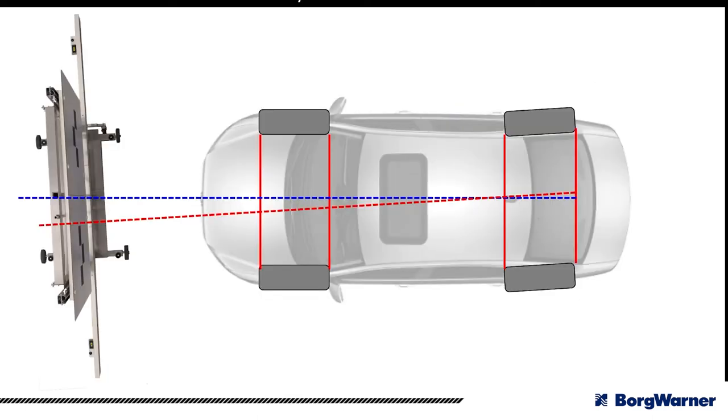The camera and radar are all set off the rear axle, which is called the thrust line. The blue line represents a straight line through the centre of the body and the red line represents the angle of the rear wheels' toe. In a perfect world the toe would align exactly with the thrust angle, but in reality vehicles are made to tolerances and will have a slight thrust angle. The calibration board is set to the angle of the thrust line and everything is set off the rear wheels. If you're making small adjustments to the front toe and the steering rack and wheel is straight, it generally shouldn't require calibration — but always check the manufacturer's guidance.